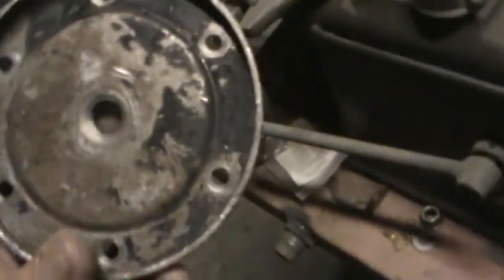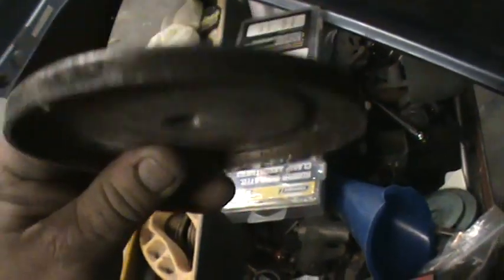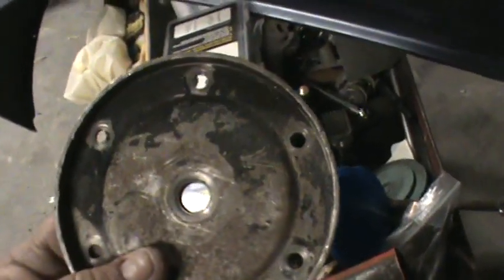If you get a strainer like this with the hole on the bottom, all you got to do is pop the drain plug out, drain your oil, and change your oil. You don't have to take the 6 strainer nuts off every time. As far as the strainer nut, I think I told you about that nut before I even sent you the motor. You told me you'd be able to handle that no problem.